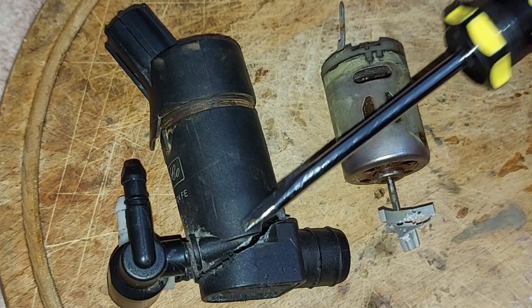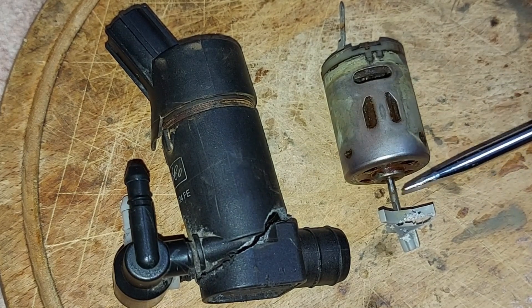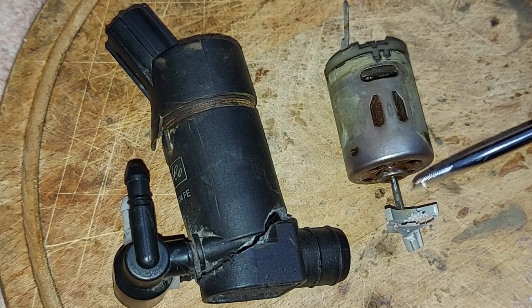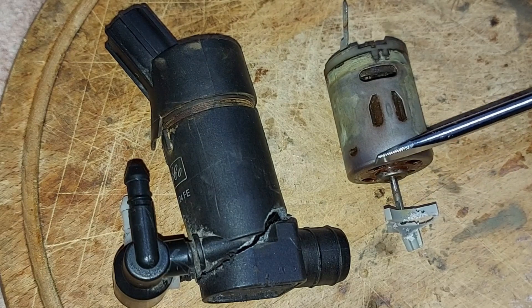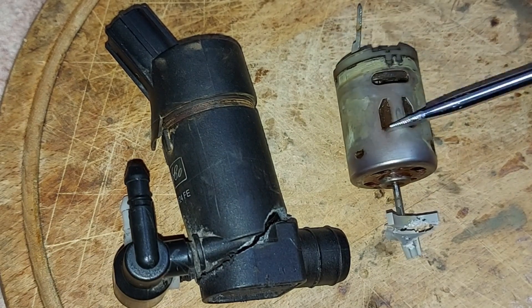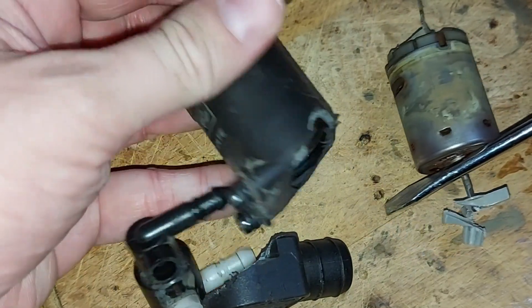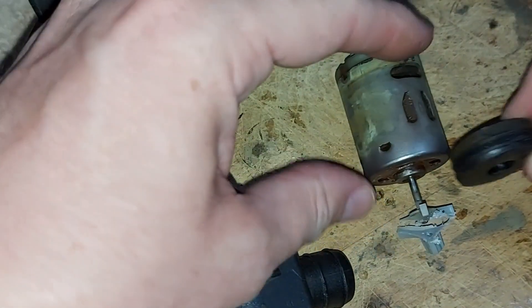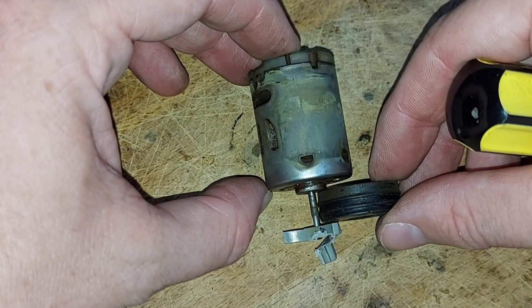I think I figured it out. In there is a big rubber seal that sits about here when the motor and impeller are within the case. And that seal separates the impeller, which is supposed to get wet, from the electric motor, which is not. I think what's happened is that the seal has failed, so water is creeping up from here and soaking the electric motor and indeed the contacts. It was pretty wet when it came out. There is the rubber seal, which sits about there. So that's my theory — I think the electric motor got wet and that broke it.